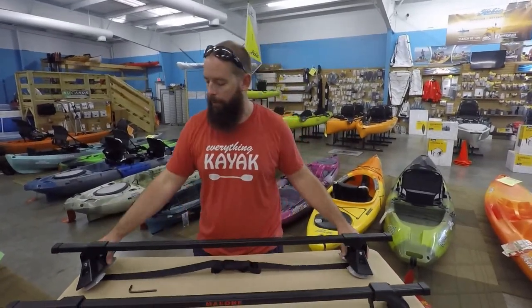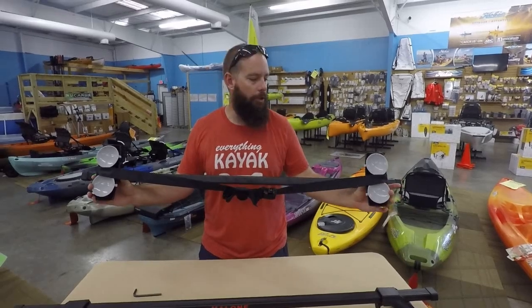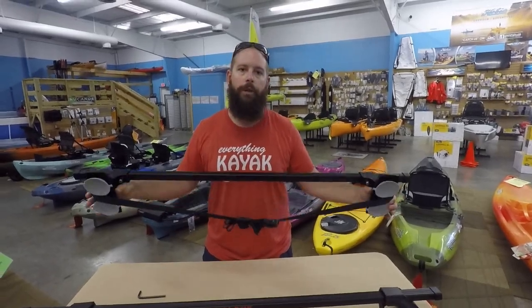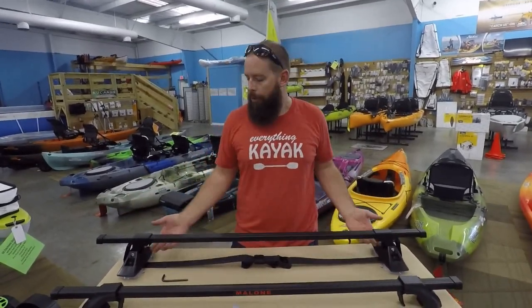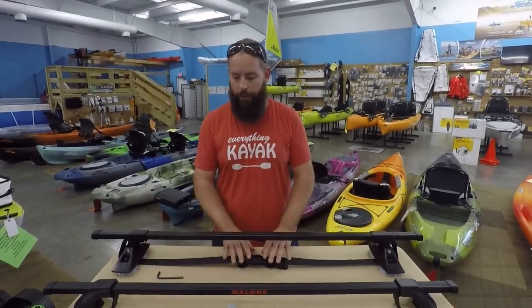On the VersaRail, you can see the suction cups on each end — these give a good firm press down on the roof of the vehicle. We always make sure we're on the outside of that pinch weld, close to the door jamb. The instructions in the kit will outline where you need to place it. You do want to tighten up those Allen bolts once you have the length set, prior to pulling the strap through.